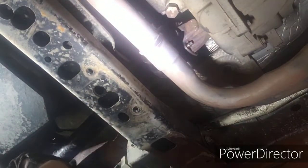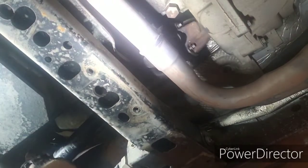This trick of spinning it by hand while you're unbolting it only works if you have manual locking hubs in the front, or you have your front axle jacked up in the air.